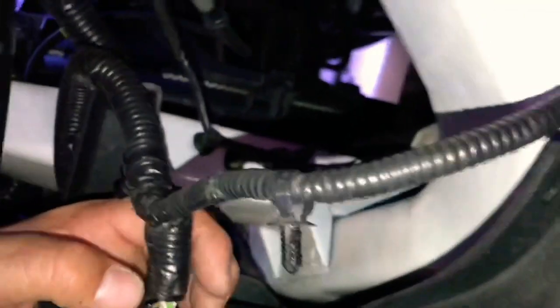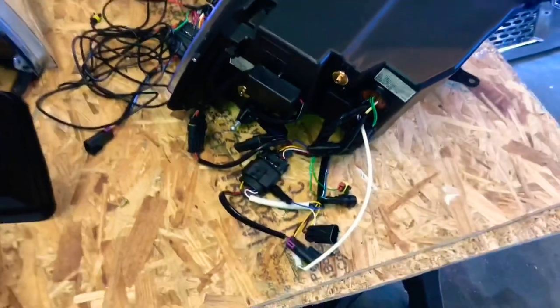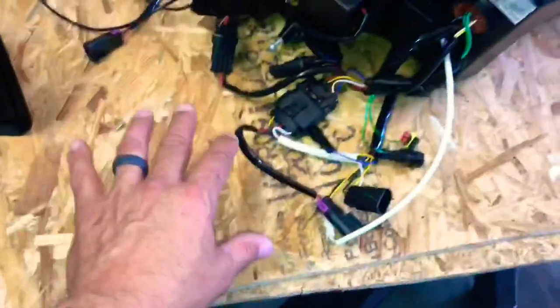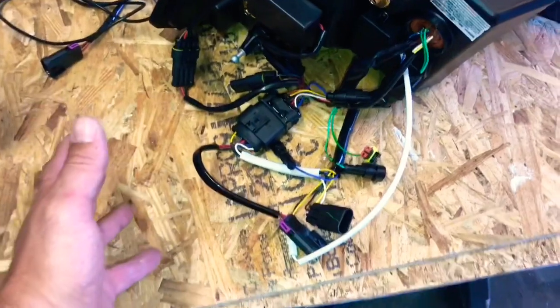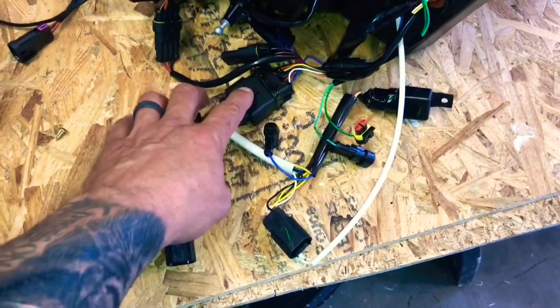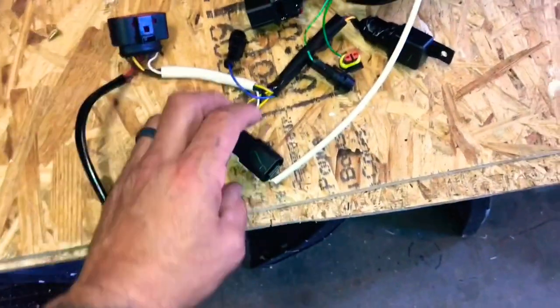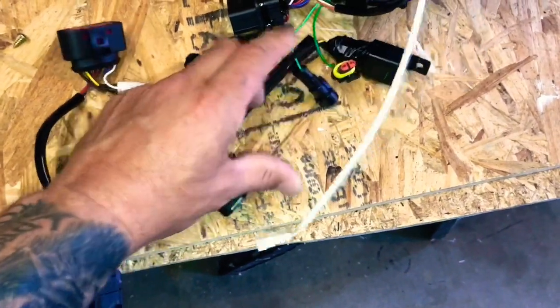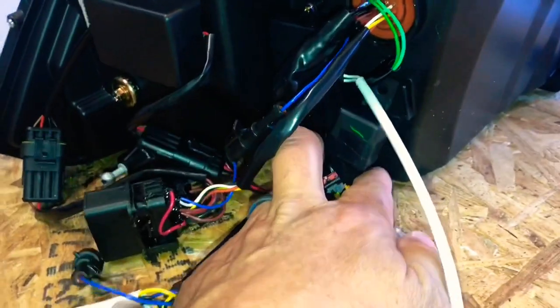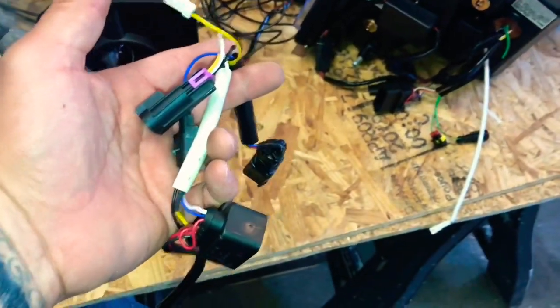Don't scratch your bumper. This is your stock headlight. Looks like my truck got in a fight — it's got a black eye. This can be a little intimidating at first, but it's actually pretty simple. If you have halogen headlights, these two plugs plug in normally and you keep this plugged in off this harness. I got projectors, so when you have projectors you unplug this and unplug the white cable, and you take this box off — there's a little screw. That separates this harness from the rest of the headlight and makes it more simple. This is just for halogen headlights only; we're not using that.